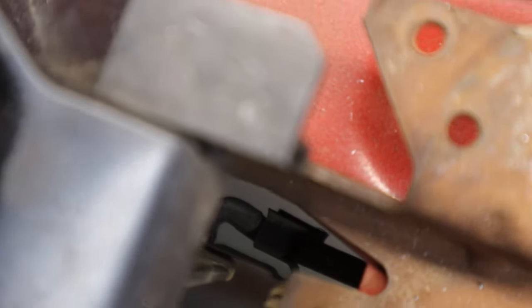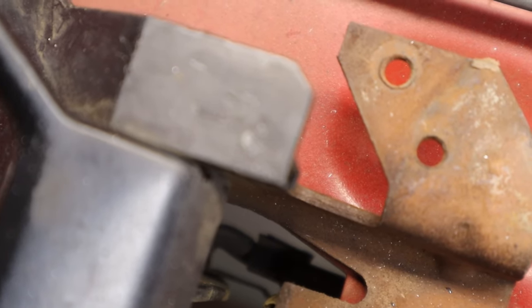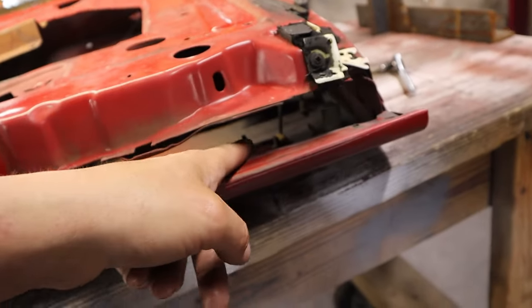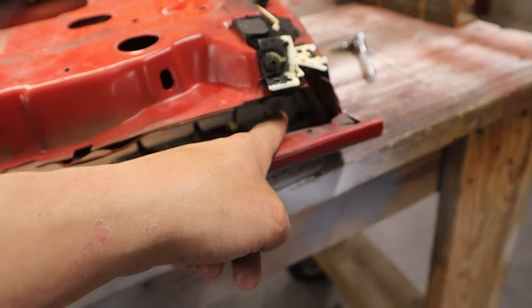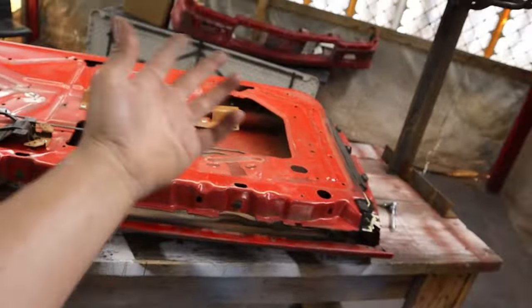I'm just going to kind of play with it and see if I can figure out how that thing pops off. It looks like it slides up and then out. But yeah, disconnect the rod there. And then take those two locking nuts off. And that little C-clamp thing. And then these three bolts. And that whole freaking thing should mangle its way out of there.